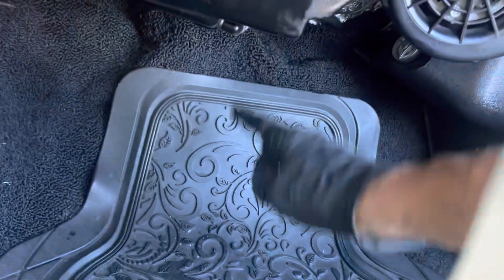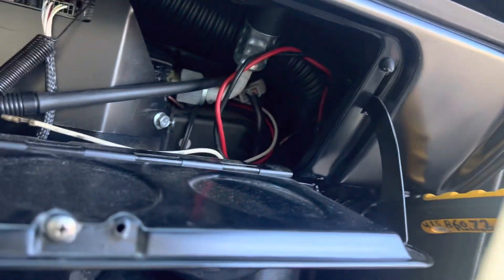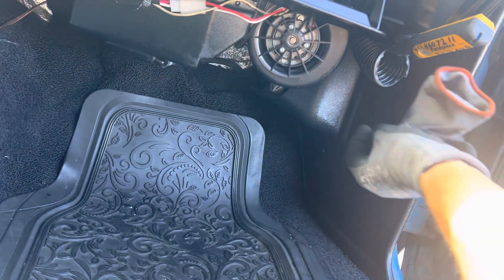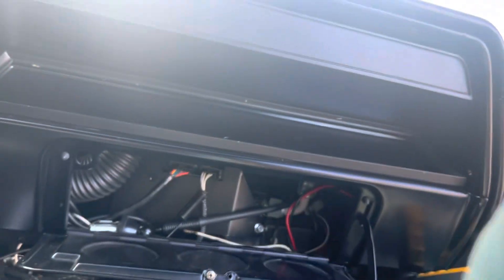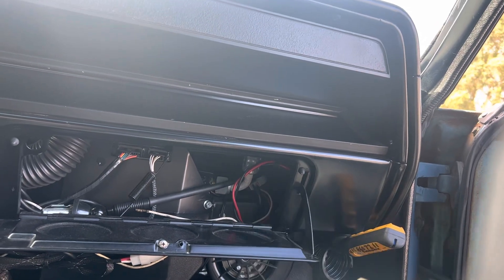He also has a little water leak down here and his line isn't wrapped. He's going to have to order a new thermistor that's calibrated correctly, because this one has a hole right here — it's factory set and should work right. I do find some problems with Vintage Air. I've had problems brand new out of the box with the thermistors a couple times.